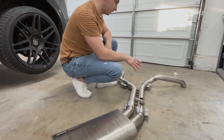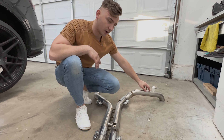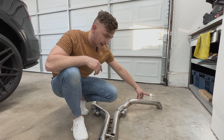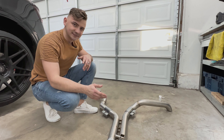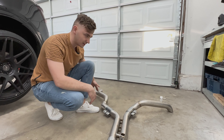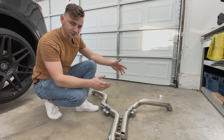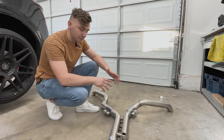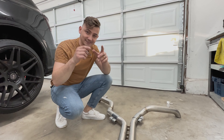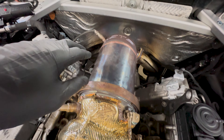Moving back, they're deleting the rear muffler. On the stock muffler pipe there's actually a valve on one side — Audi only put a valve on the right side and no valve on the left side, which is super weird. It only opens up in dynamic mode, and I think it was a great idea that Integrated Engineering removed it. I'm super excited to hear how this exhaust sounds.